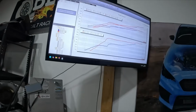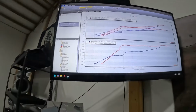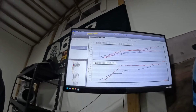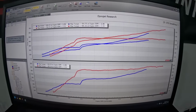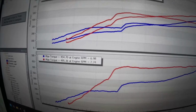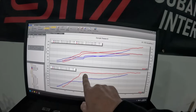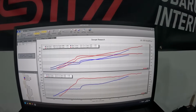Golly. Well, we're gonna go ahead and take a look and see what happened. Yeah, the torque was a little bit hot on that one, let's say. But honestly, 50 more foot-pounds of torque, but god damn, 125 horsepower more. Not bad for a stock K. Nice flat torque line, 495. And then boost is running away up top, hitting it at 18.5 pounds here, and then it's climbing all the way to 26.